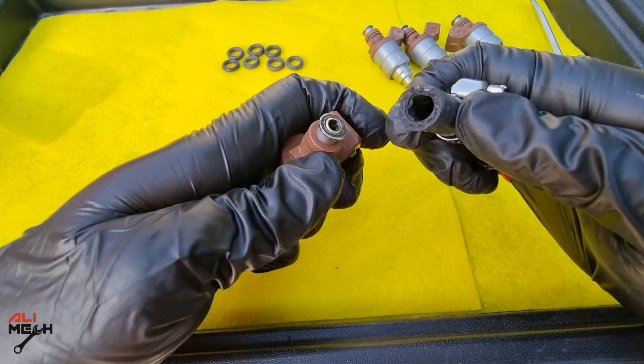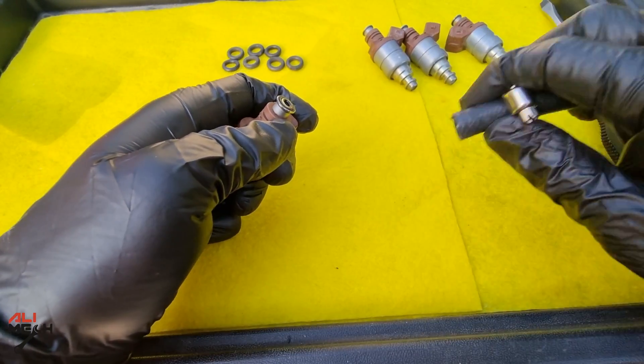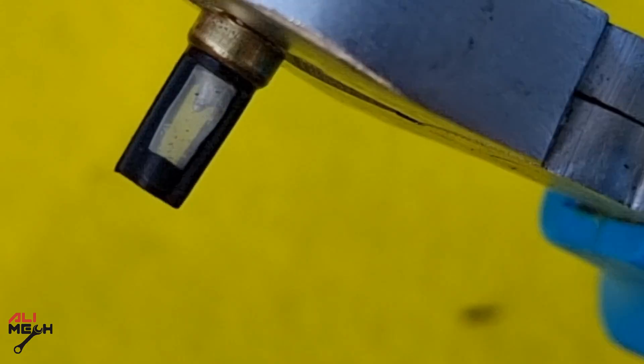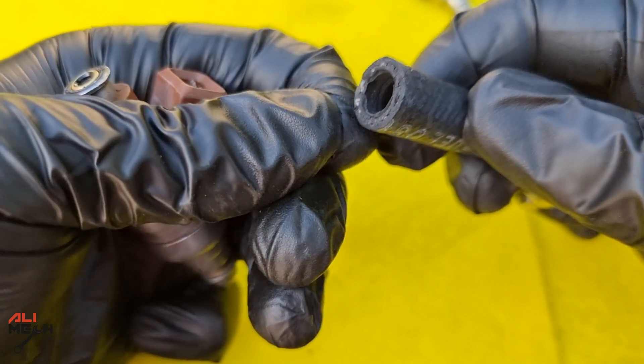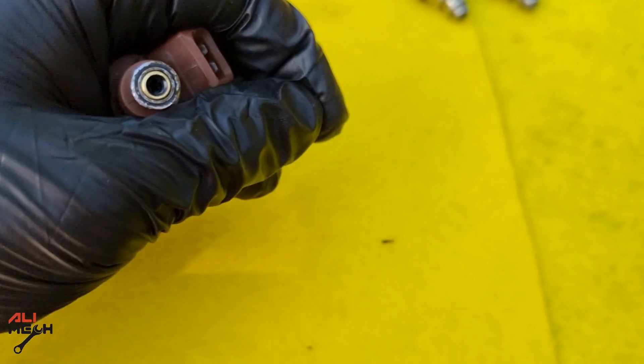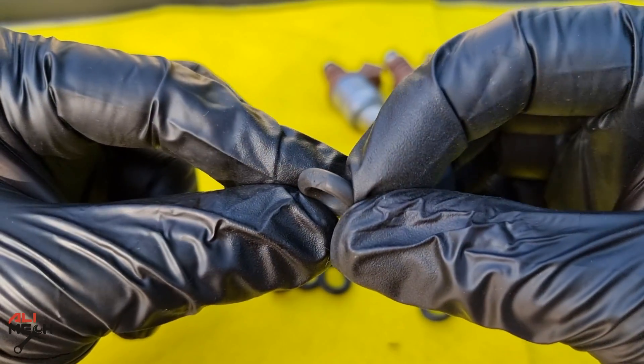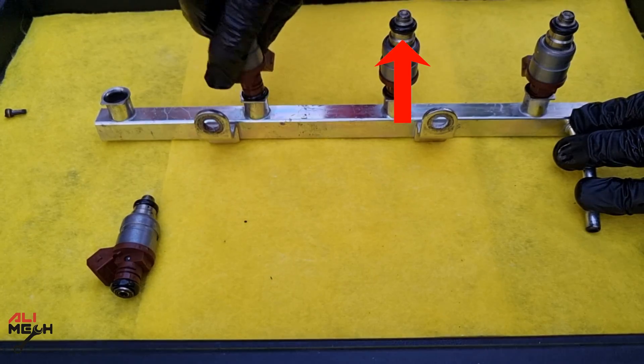Don't forget that you need to release all the pressure before removing the hose adapter. After cleaning you might see small particles from the hose — like that — in the filter. That's why I recommend replacing the filter again after cleaning, and try to use a different hose for the adapter as well if you see small particles.